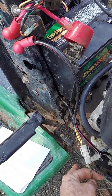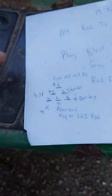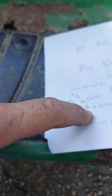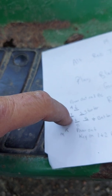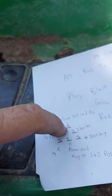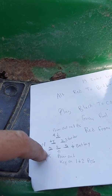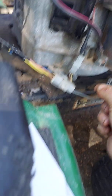I also have the Y terminal on my switch. I have an extra ground and the Y terminal gets power from the battery, so I jump the battery positive to the Y. That way in my third position, when I turn the key back, that sends power to the A terminal which is running my lights. And of course the ground — M, as we mentioned, means magneto, which is kill, which runs back to the black wire to ground your coils and kill your engine.